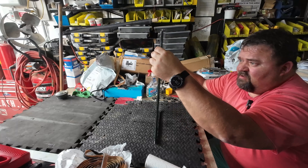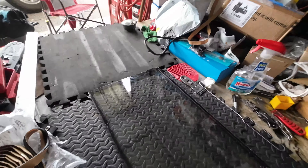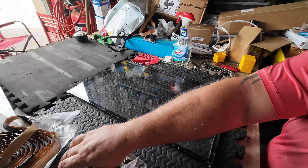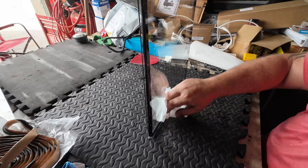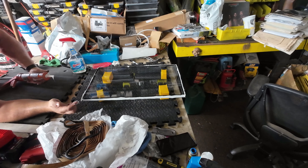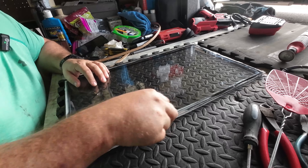There are a couple of air gaps in there. I'm going to fill around the edges with silicone. You can see where the butyl is contacting. I think all the remaining fingerprints are on the outside — I hope. It don't look too bad, it looks pretty good actually. It looks clean. I'm just going to fill this gap. One dual pane RV door window. Let's clean this window up and get some of the silicone off of here.